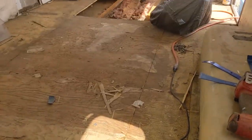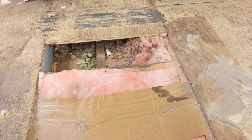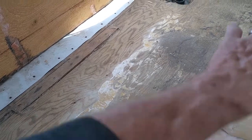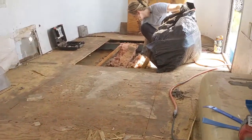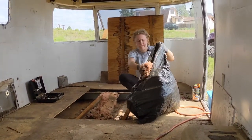Just run it through at an angle like that, and because I'm only cutting through maybe a sixteenth of an inch of plywood it goes really fast. We'll rip this up and then put in some furring strips along the edge when we replace the flooring. This piece back here is kind of soggy and soft, so we'll replace this whole section in the back — you can see where it's rotted over there. Get the Argosy going and not smelling like rat poop!